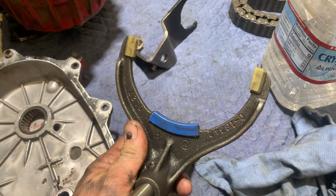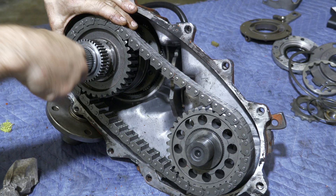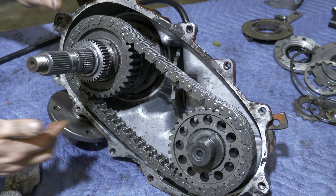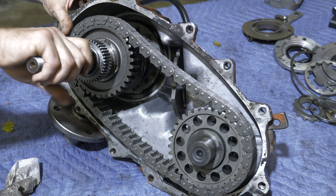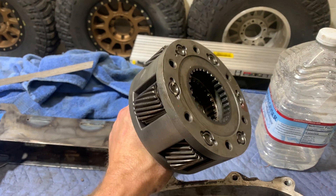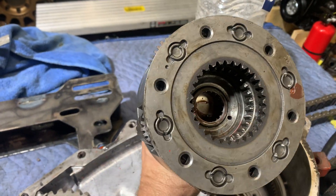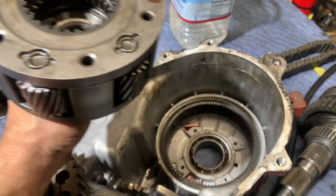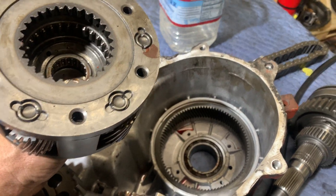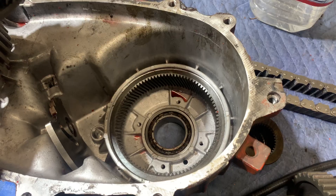These are the shift forks that will live on here and give you your nice shifter feel. Here we can see the box in two-wheel drive — one rotation of the input goes directly to the rear drive shaft with no transfer of torque through the chain. As the shift fork is moved back it will engage and we get four-wheel drive. One of the most common mechanical devices you will find in transmissions and transfer cases is a planetary gear set. This is the planetary gear set out of the NP241. These are the planetary gears and inside you've got what's called the sun gear. I'm going to put this into the case so you can see how the mechanical advantage is created through the opposite rotation of the planetary gears to the sun gear to the ring gear. Don't worry, I'm not going to get too technical — there are tons of videos out there that can explain this better than I can, but just a quick visualization while the case is apart might be kind of cool.